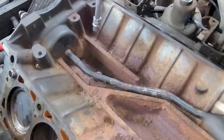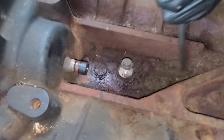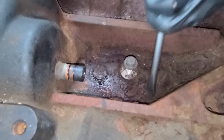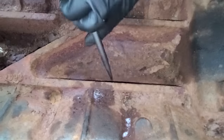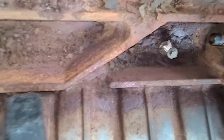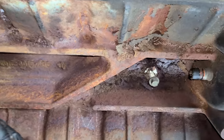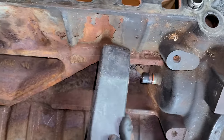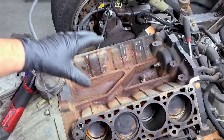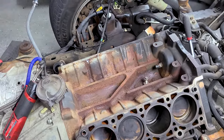Get the knock sensor out of the way — this coolant tube just pulls right off. We're going to use a screwdriver to agitate all this dirt and scaly rust from this cast iron block. All right, we've got the valley clean enough for this video. Prepping and painting a block is for another video.